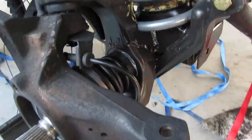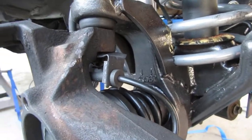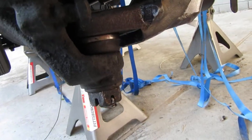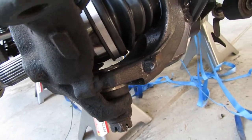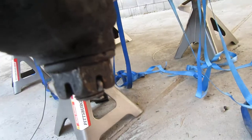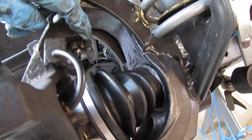Here's a little update since I connected the right front upper control arm. I got the knuckles in — here's one knuckle, the other castellated nut, and also the lower one. I found on a forum that they get torqued to 80 foot-pounds on the lower and 75 foot-pounds on the upper. That makes sense — I've heard other stuff elsewhere but always heard this one was 80.